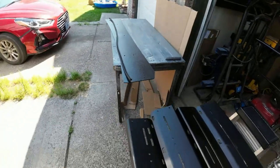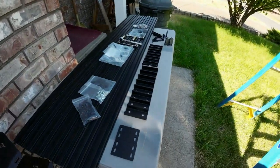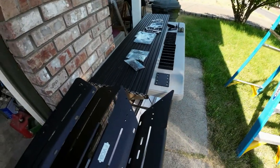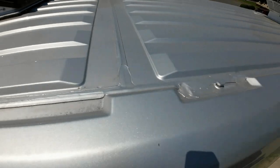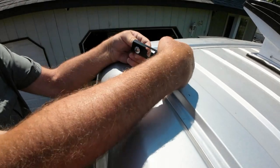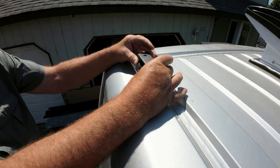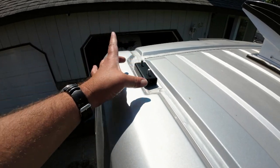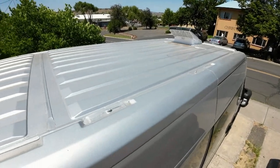We're going to go ahead and get all this put together and hopefully have a rack install today. Then later, once I get the solar panels out, we'll reposition our rails and get them at the proper distance, put the solar panels up there, get things wired in. The first step is we have these metal studs — there's four on each side going down the length of the van — and we're going to install the brackets. Got the studs through there and it just sets like that, then the top cap. When we get ready to put the side rails on, we'll put the nuts and bolts on there, snug it up, keeping everything fairly loose until we get things in position, then tighten it down.